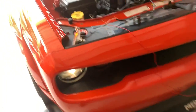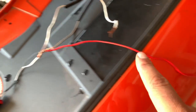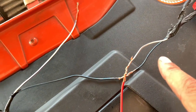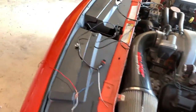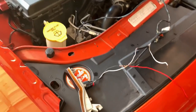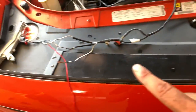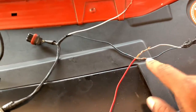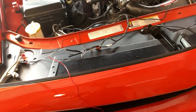It wasn't too difficult — I just added that jumper wire and now both turn signals work. On the passenger side you've got power and ground, then the jumper wire goes over to the driver's side for power and ground. You've got your ground, your power, and your jump wire. I measured it so it goes across the harness — we're going to tape it all together going to this connector, you've got your ground, disregard this power, and disregard this wire. Now we've got to solder everything and clean everything up and we'll have a nice solid harness.